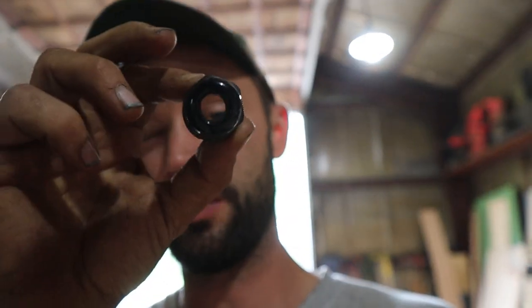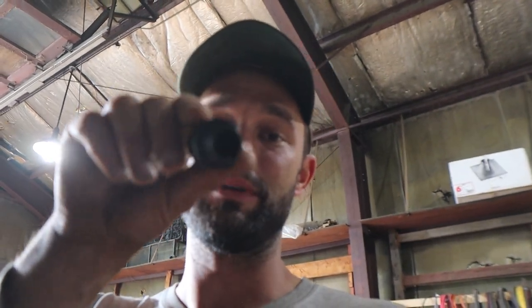I'm going to need Jeet's help real quick. The way I like to do it when I'm doing alternator connections and have to poke through the floor is I use these waterproof glands. We poke a hole into the floor, go right through the subfloor, and then I put this gland in there. It's got a waterproof rubber part where when you tighten it, it will be completely waterproof and we seal the inside. So we have a way to pass a wire through the floor without any issues with rust or water coming up through the hole, especially because we're going to be behind the tire — we want to make sure it's nice, sealed, and secured.